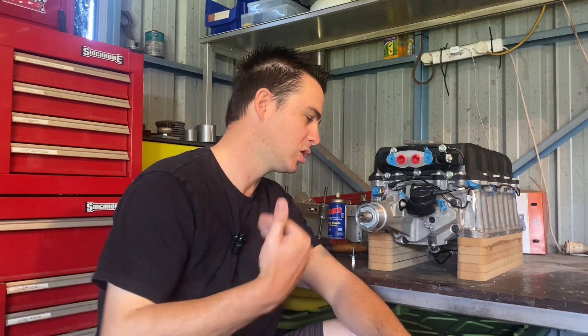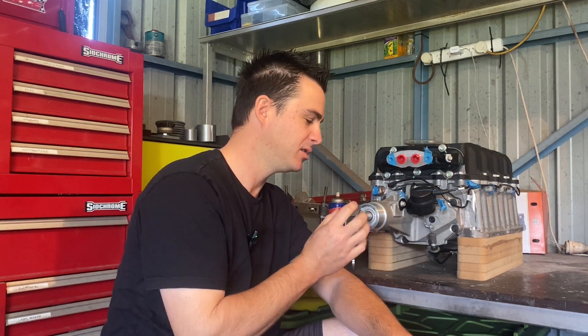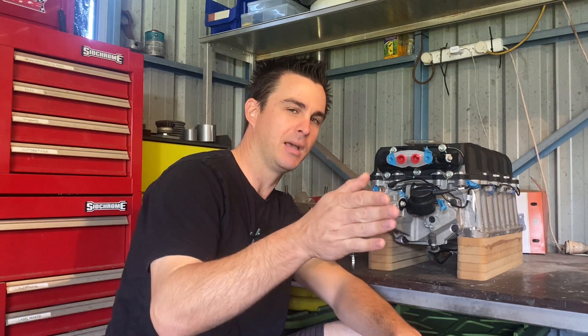I'm not really about that and I don't really feel like pulling the snout off of this thing, to be honest. I just want to whiz it down so I can make my new pulley to fit over, bring that belt alignment further back so it fits on my Toyota 1UZ V8. There are a few companies that make a tool you can just buy to do essentially what I'm going to do now, but I try and save a buck wherever I can. So let's have a look at it.